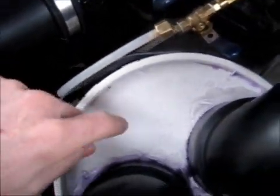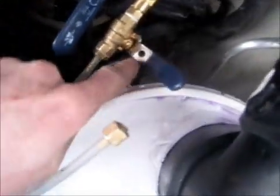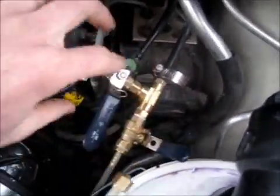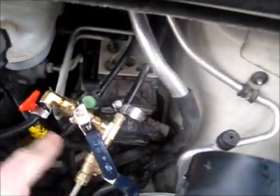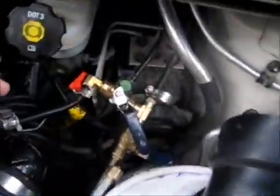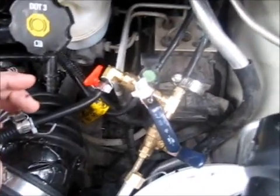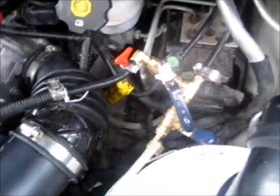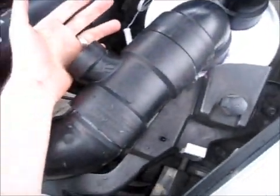I do have gas in this bucket. You can see the fuel line going to the bucket is shut off and the line going into my engine is shut off right now. I'm gonna open this valve up just that far — good enough to start my car. I just need to figure out exactly how much restriction I have on this end to make it startable. Right now in this phase of testing I just have it turned on so I can start my car, then work my way into shutting the fuel completely off and having it run through the vaporizer.